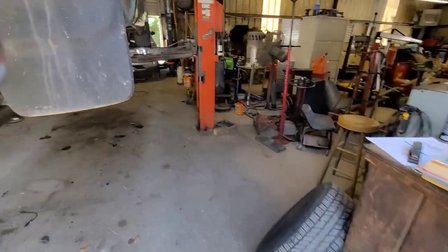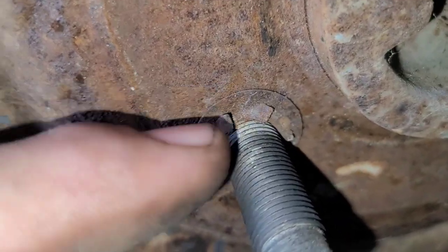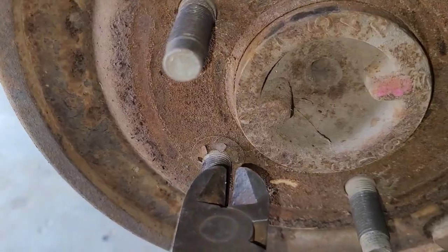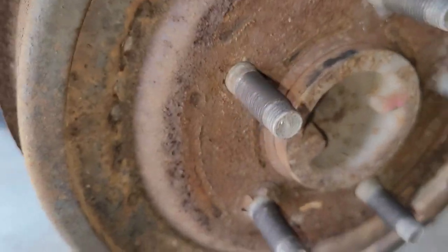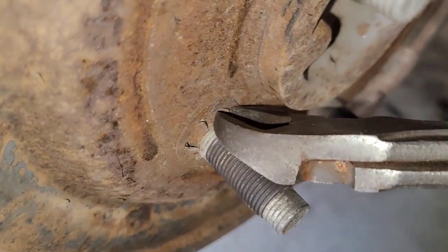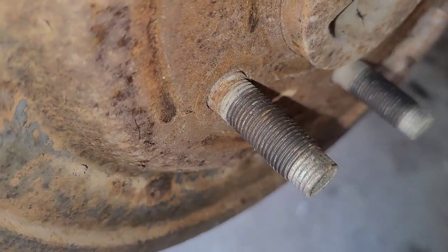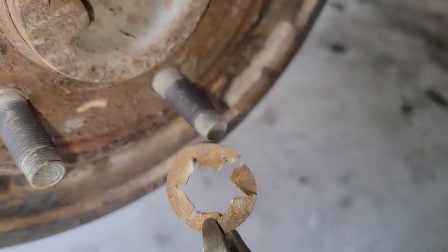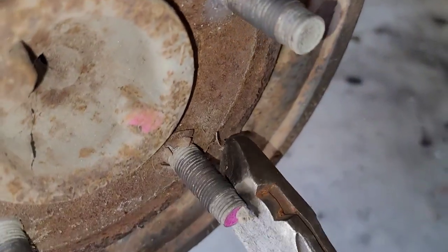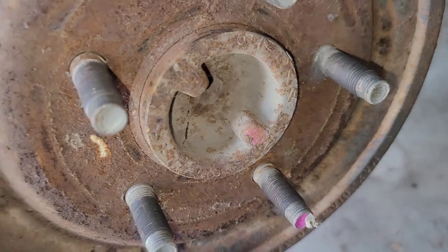I need to get a pair of cutting pliers. You use cutting pliers, grab one of these little tangs here, and you pull up on it and basically rip it off. You've got to grab the little flute there and rip it up and out, and then you can get that clip off relatively easy. There is no reason to save this — throw it out. Sometimes it can be a real pain in the neck to get off; if so, just try to jam a screwdriver behind it to get a little room away from the drum.